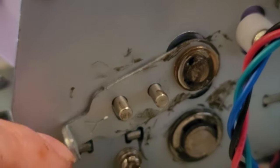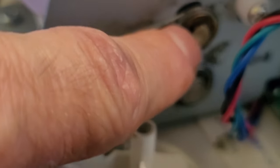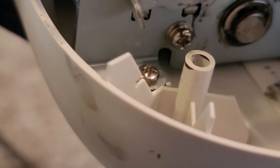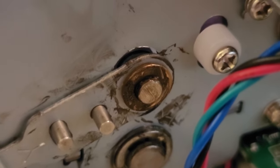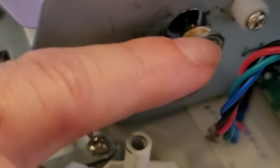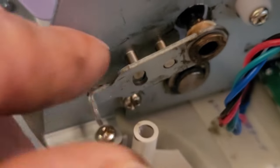We're going to remove the top clamp and this little bracket right here — not the bottom one. I removed that C-clip off the rod. Now you can pry this bracket off; there may be a washer here too. This bracket has a brass bushing that's pressed into it, so when you remove it, that whole piece with the brass bushing will come off of that rod.